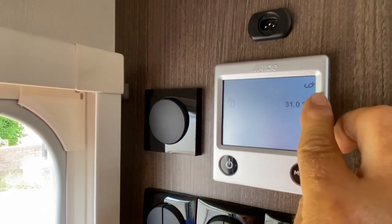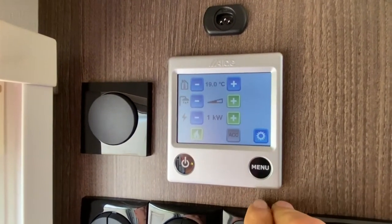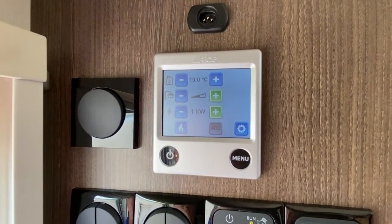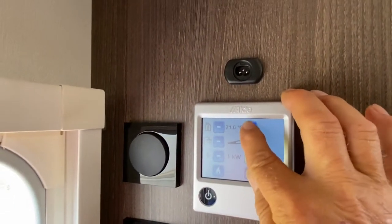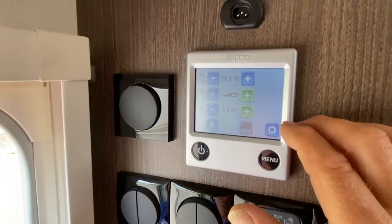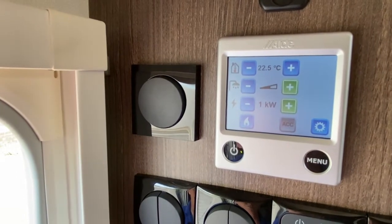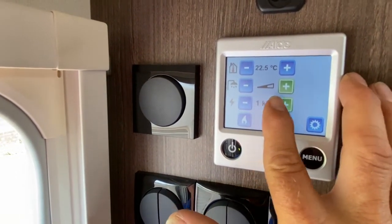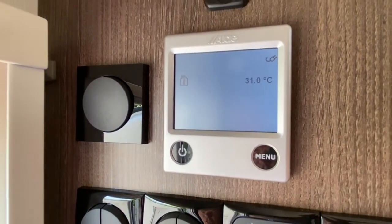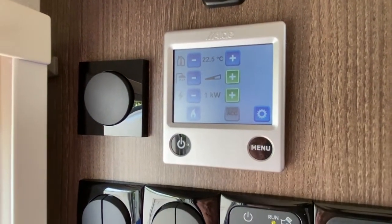Also on the screen in the top right-hand corner you've got a 230 emblem just to let you know that you've got 230V coming into the caravan. Pressing the menu button takes you into the main menu. The top one is your central heating temperature gauge — this allows you to set the temperature to whatever you require, up to a maximum of 30 and down to 5, which is its lowest setting. The symbol below with the shower head is not a hot water on/off switch; it is purely a boost button. The wedge is half filled — if you turn it on full, that shuts the circulation pump off for half an hour while it concentrates the heat all around the hot water tank. After that half-hour period it will revert back to half fill and your circulation symbol on the main screen will return.